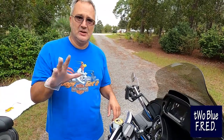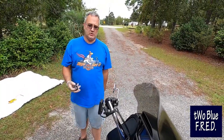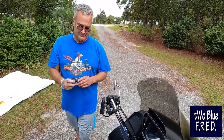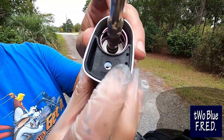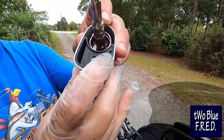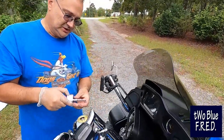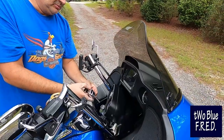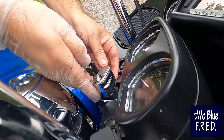If you guys have any questions on that, feel free to leave those down in the comments. So we finished our work that required us to remove the ignition switch, so we're going to go ahead and reinstall it. I didn't show this before — you see that little knob right there? That's what you were pushing on with your screwdriver. You're just getting your flathead up against that and pushing it up. We're going to go ahead and reinstall it. There is a spring, so make sure you've got your spring in there. We're going to make sure that we have it in the same orientation that we had when we pulled it out, which is hard over in the fork position.